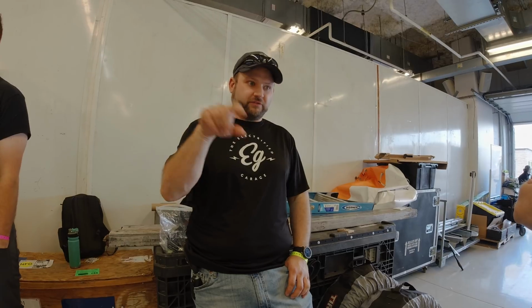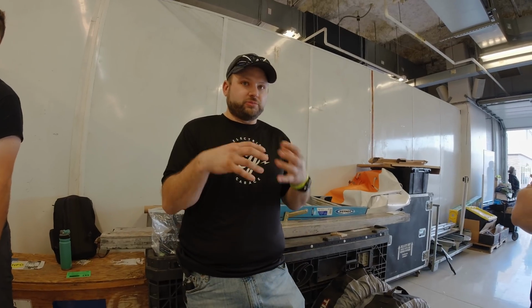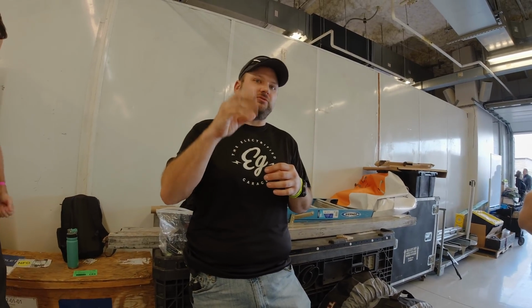So do they actually cool the actual rotor on those? Yep. They do. So the Model 3 does it a little different. So those have coolant pumping through the powertrain. Uh-huh. Model 3 is oil cooled. Oh, oil, okay. And then they have a filter, and then they have a heat exchanger. Oh, no way. So they pump the oil through everything with a pump, and then they feed it through the heat exchanger, so it's a little bit more efficient that way. Because with coolant, you need massive amounts of coolant to cool things. Whereas the oil absorbs the heat, and they can get it through the exchanger really rapidly.